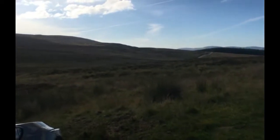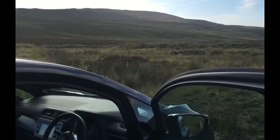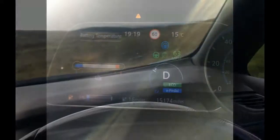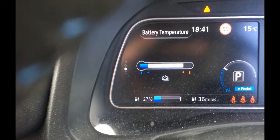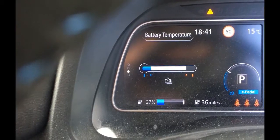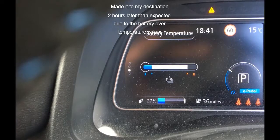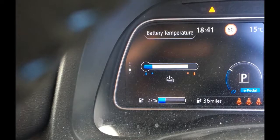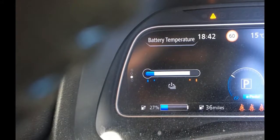I'm on the way now. I went up a fairly serious hill — 500 metres above sea level — and after coming up here the battery was up in the red. It's actually just fallen back down now after a couple of minutes. I'll let it cool down a bit more, because I guess it's going to warm up as I go down the hill and it regenerates, pushing power back into the battery. I'll give it a few minutes, maybe get it down one more segment, and then set off again.